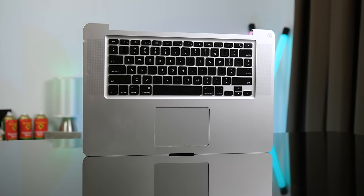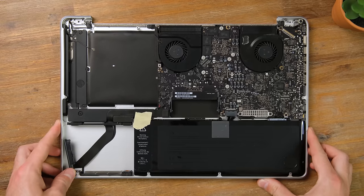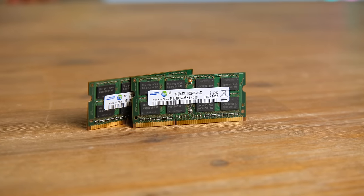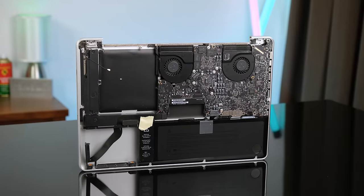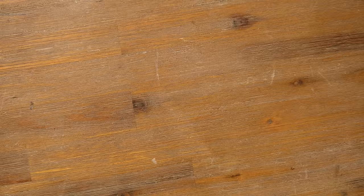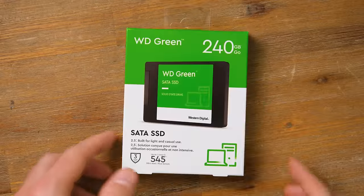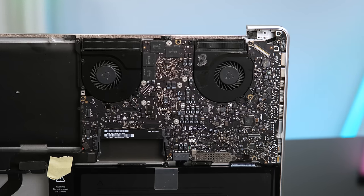This here is the headless laptop, and I believe it was mentioned as being a 2012 model, missing quite a few components. I put a bit of tape over the battery to simply hold it in place for now. To test this out we're going to need some RAM, ideally two sticks for maximum performance — 8GB in total would be ideal, however we should be able to get by with the 4GB I had lying around. There's an empty slot where an optical drive used to be, which I plan on filling with a SATA drive adapter I had lying around unused in a drawer. For backing up files we can use a random 500GB drive I pulled out of a dead laptop, and as our main drive we can use this inexpensive solid state drive that was only 22 Australian dollars.